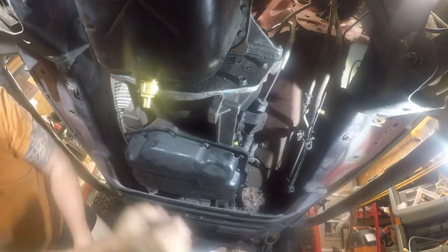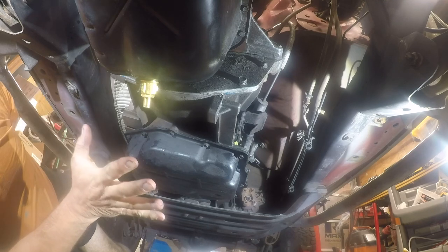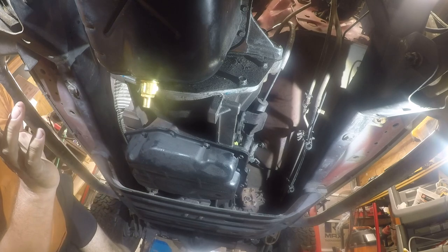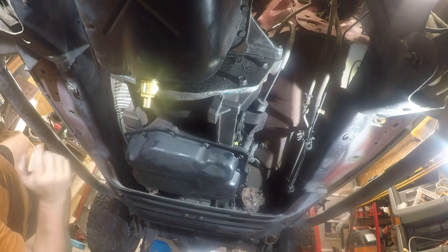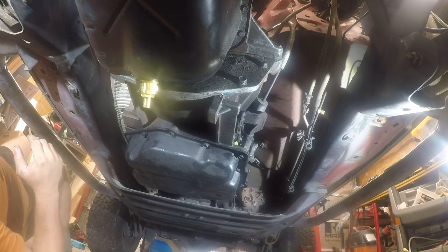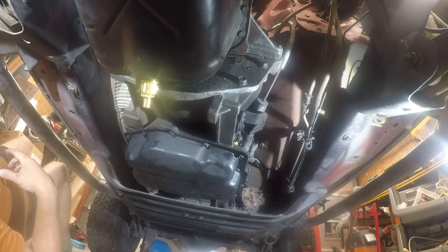All right, so all the bolts down here are now installed. Transmission's coupled to the engine. Flex plate's torqued down. Dust shields in. Wiring's taken care of. Really, the next thing to do is the engine mounts, and I don't want to mess with that tonight. I could put in the starter. I'm down here. It's something to be done. It ain't gonna put itself in.